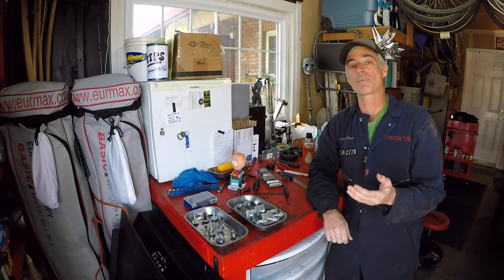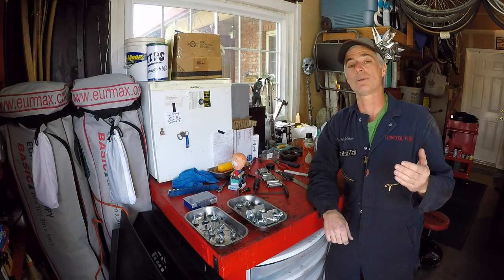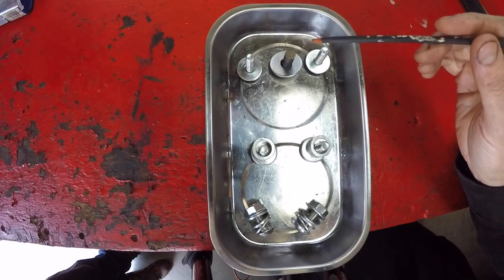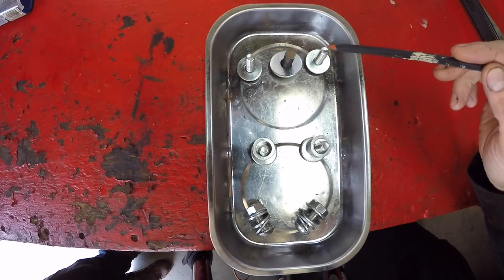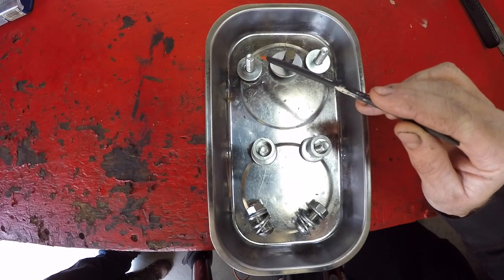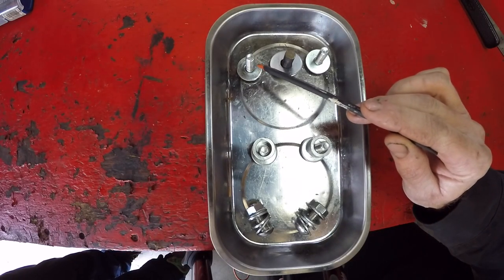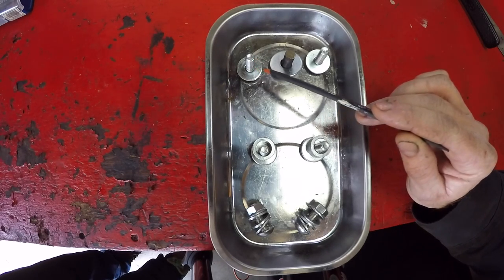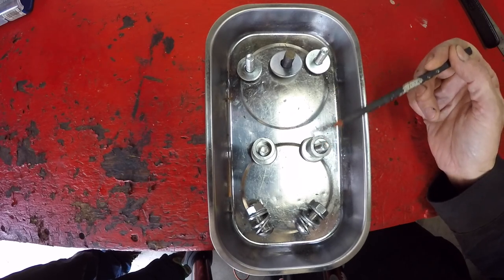Let's start by showing you all the necessary fasteners to get the front and middle skid plates onto the rig. Here's the fasteners you need for the front skid plate: three M8 bolts with a 125 pitch. The instructions say to just reuse your factory ones, but I replaced the original ones because I wanted ones just a little bit longer. These are M8 bolts with a 125 pitch and they're 30 millimeters long, similar to the ones CBI provides for the bolt holes further back.